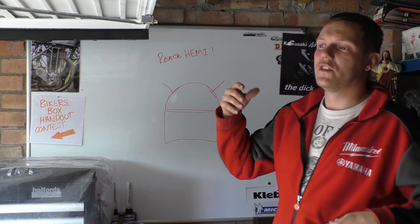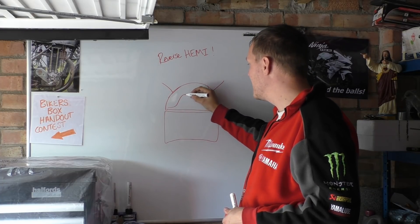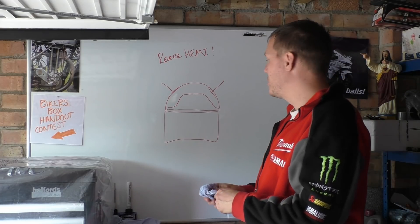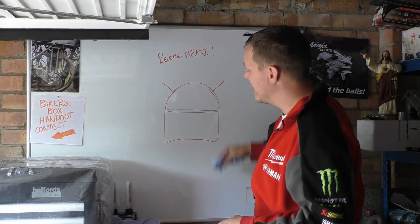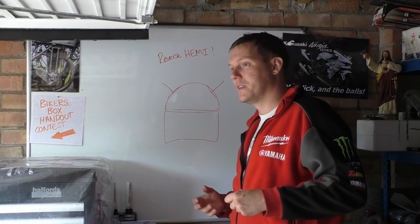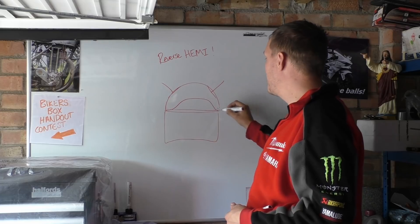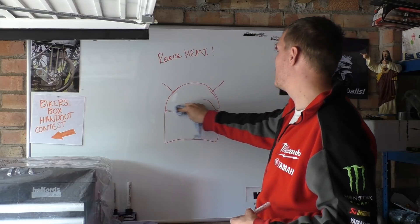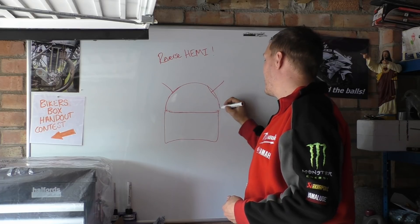Now loads of people started going about newer engines, newer V8s and all the rest of it, where it's not exactly a hemisphere — it's kind of like this — well, that's close enough most of the time. It's an evolution, still trying to stick with this hemisphere idea. The problem with the hemisphere is surface area to volume — you just can't get high enough compression ratios. What you can do instead is stick a piston in like this, but then you're kind of losing this whole idea of the perfect hemisphere. It's all about geometry, and geometry dictates that you can't really do it.